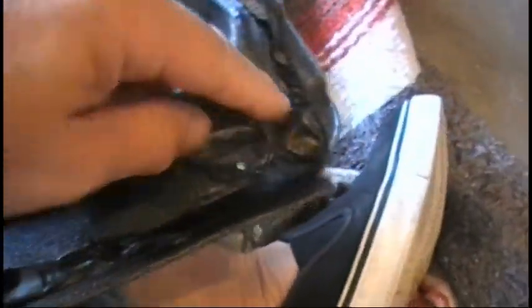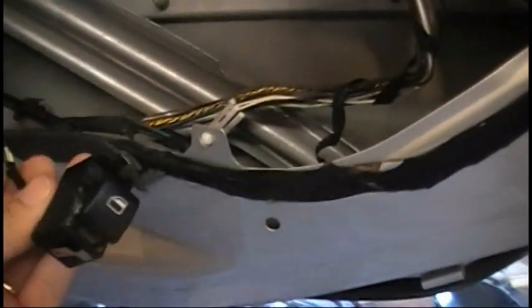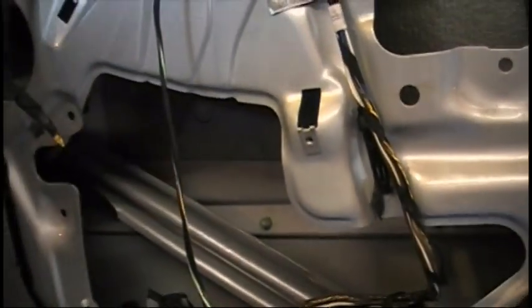This rubber insulation or barrier is on the door then. What I did is I just took an X-Acto knife and cut along the edges where all the putty, or whatever this glue-type material is. I left it on the door so I could just stick it right back on again. I disconnected the power window switch — I plugged it back in again because I was messing with it trying to figure out what was going on. And the speaker wire here, you have to unplug that as well. So I got all this out of the way and then I removed the regulator.